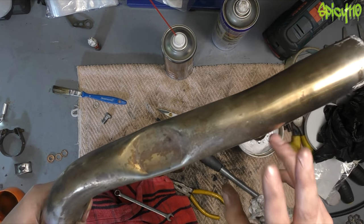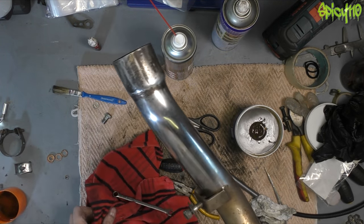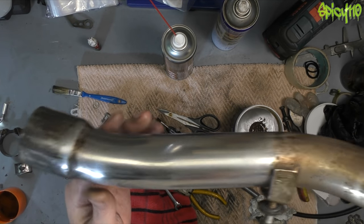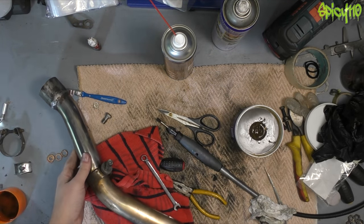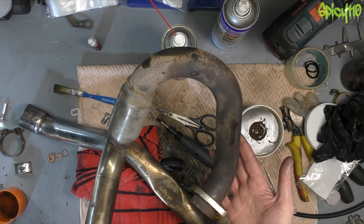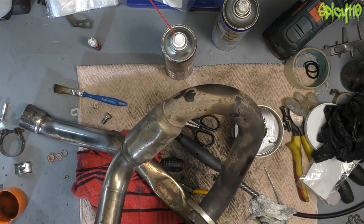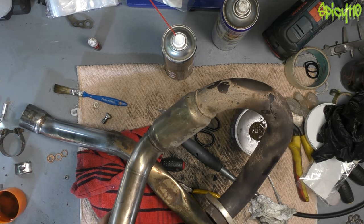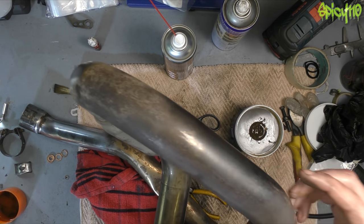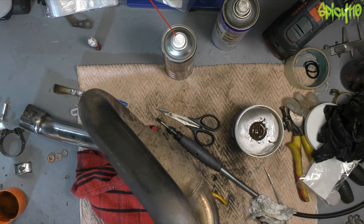This is the exhaust — this is the not-so-bad bit, and I tried it out and then went over it with some sandpaper and just buffed it on a buffing wheel. Nothing too major, I'm not going for a mirror polish — there are some scratches in this, but the difference is amazing. So what I'm going to do is basically paint it with phosphoric acid repeatedly, including the much worse bit, and then go over it with a light wire wheel or with sandpaper up the grades a few times, get it up to about a thousand grit, polish it off a bit, and it'll be fine as long as we can get all that crud off.